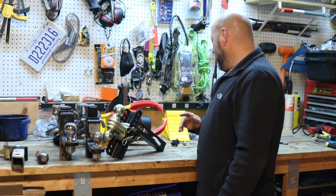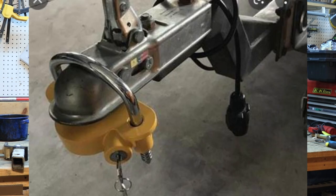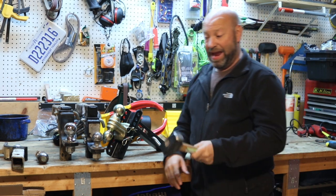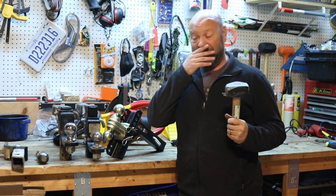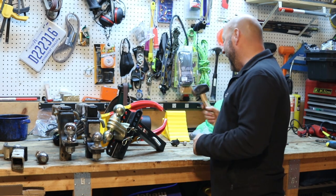You see these coupler locks that go right into the coupler — they bolt over the top, or they're cast steel that clamps in. Those are kind of a joke in the industry because they're easy to knock off. I don't care if you spend $200 on one — the $25 to $30 coupler locks, if I come in with a hammer and hit it, it pops right off instantly. If they mount on the front and they're cast, one crack shatters them and they fall right off. Not a fan of hitch coupler locks like that.